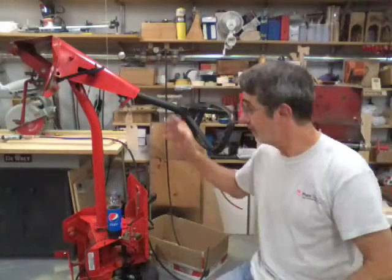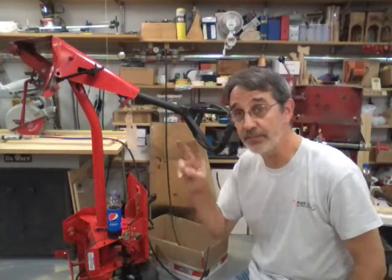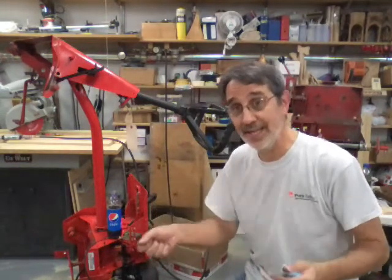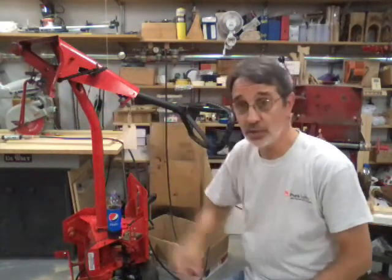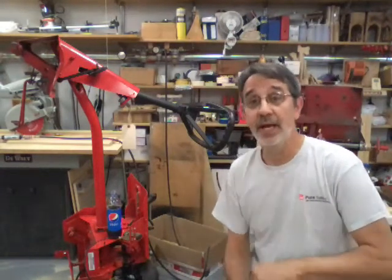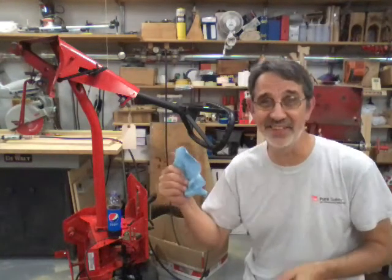Well, that's it. We have the front end assembly in, the new pilot bushing in, the cables hooked back up, and all the wiring hooked up except for those two plugs from the safety switch on the mower deck that tells you the deck isn't engaged while you're trying to start the engine. Next we're going to be putting in the new bushings for the kingpins and getting the linkages hooked up. If you have any questions, throw them in the comments below and I'll answer them there so everybody can benefit. Don't forget to subscribe — work safe, have fun, and we'll talk to you soon.